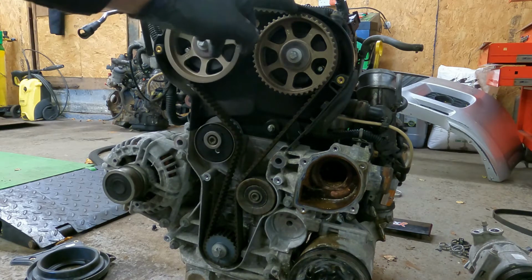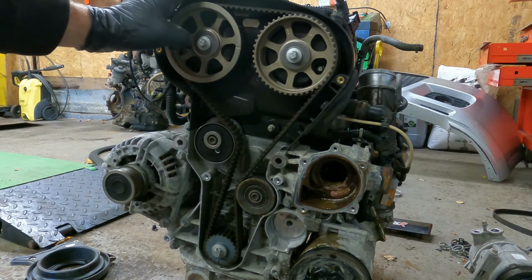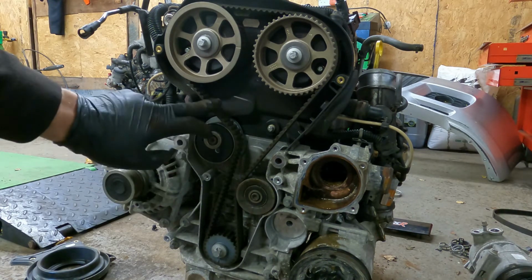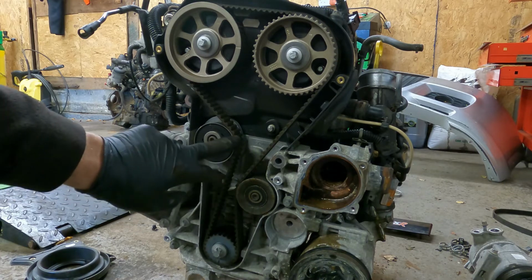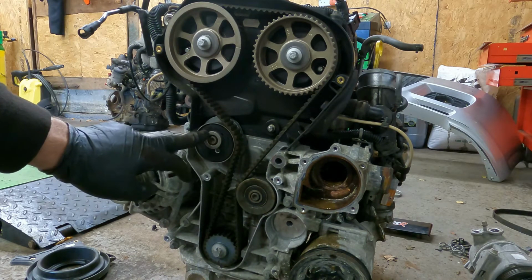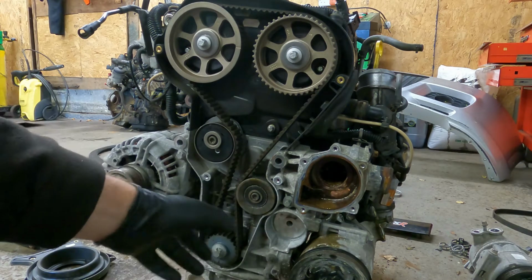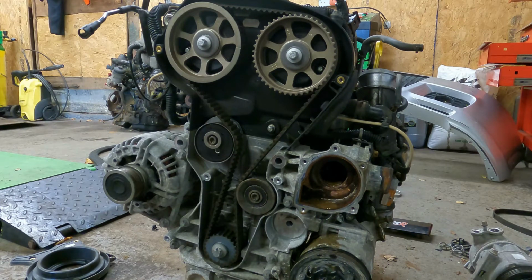And this engine, the VXR, but all of these 1600 engines, Vauxhalls, and the 18s as well, like the twin ports or the XERs, XEPs, they're just all the same. They're dead easy. You just need to lock the cams, and it's got an automatic tensioner, so that's the easy bit. Because when I started doing timing belts in the old apprentice days, the most scary part for timing up an engine wasn't timing up the pulleys and stuff. It was setting the tension. But this is just automatic. It's like the auxiliary belt tensioner. You just take off the tension, put the belt on and release it, and then it automatically tensions. So if you're new to timing belts, these engines are probably the easiest ones to do. But I'll show you anyway.